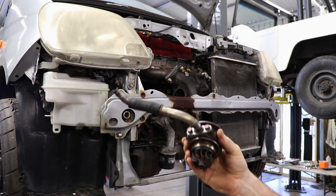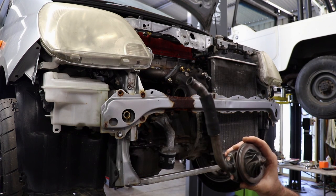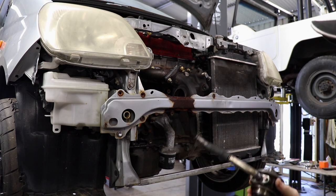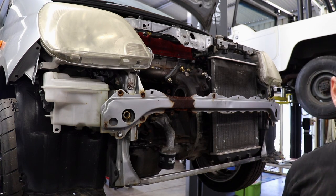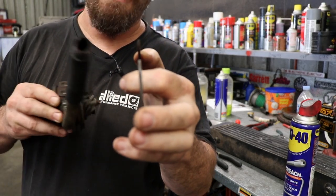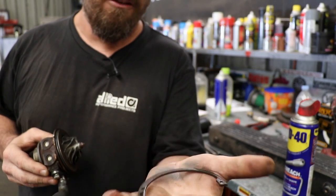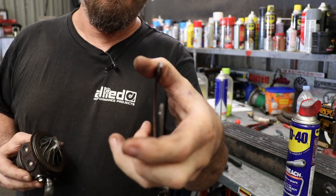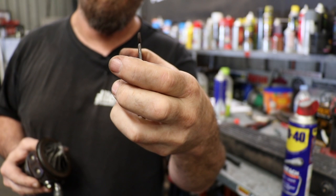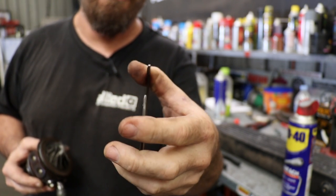There's the oil drain — I'm going to glue that on and put the o-ring back on. Probably put a bit of glue on that o-ring too because it's getting a bit old, so every little bit helps. These big snap rings have got a tapered edge on one side — that bit actually goes at the top, so it sort of helps it lead in, slide into the compressor and pull it in hard. You've got to get them around the right way — if you put it around the wrong way it'll just make it extremely difficult.